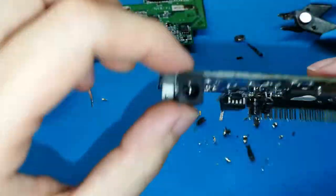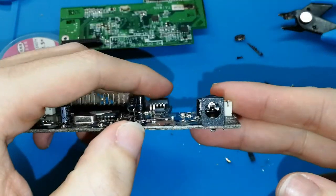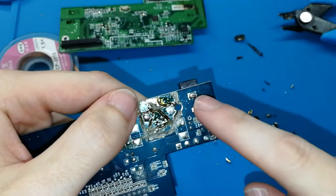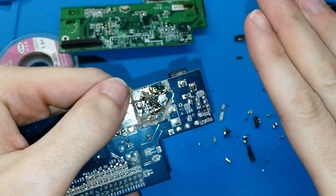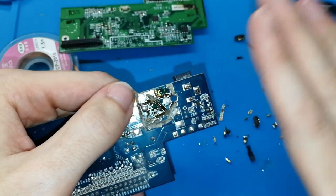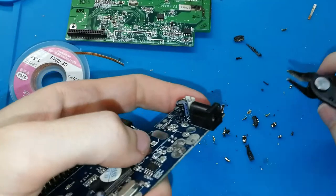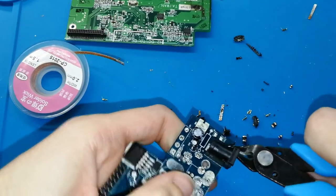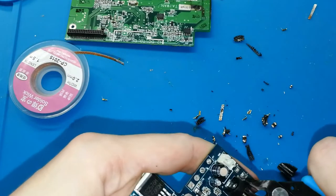Take this tool. We have here another connector. This is most similar to the other one, so we can use this. If you try to desolder, in this case it's 3 legs, in the Game Boy Color board it's 5. If you try to remove the tin of all legs at the same time, it is really hard. You will need a solder iron with a big tip, I have this super hot and it's hard. So it's better, again, like with this board, you destroy this. Can you see? This is super easy. Destroy, because you don't need the connector for anything. Destroy, take your time, destroy.